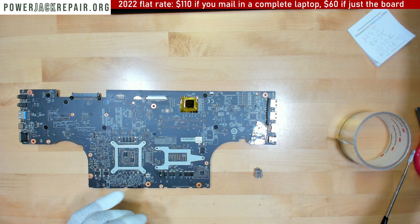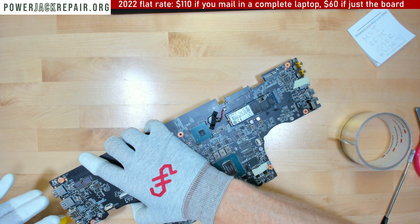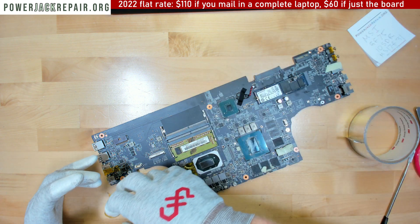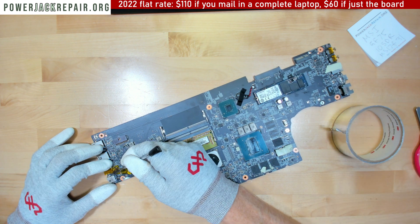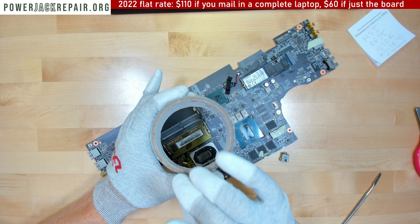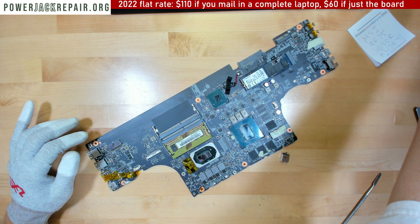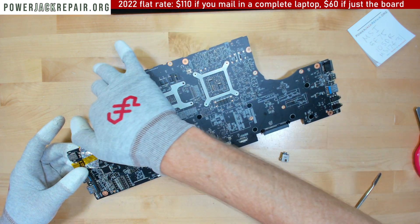On the connector nearby I'm just going to use the Kapton tape. Kapton tape is also going to hold that aluminum insulation in place. On this side, all of those components are usually sitting quite well, so you don't have to use the high-temperature insulation — it's ridiculously expensive. It's not some tape you can buy at the local hardware store; it's like 20 bucks for just a small amount. It says 'energy saving product' but the link should be below. I mostly use it for little places where I know there's a chance a component might come off the motherboard.